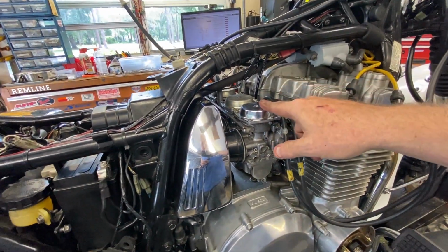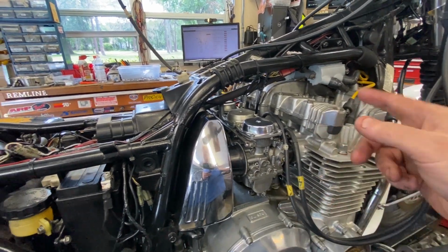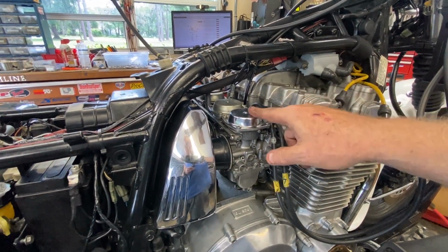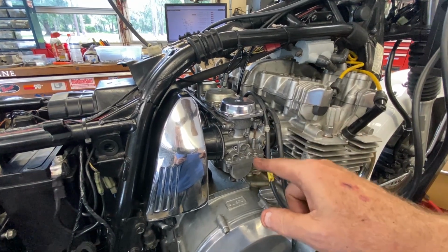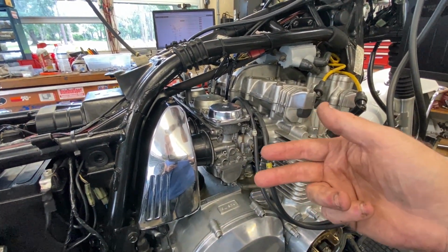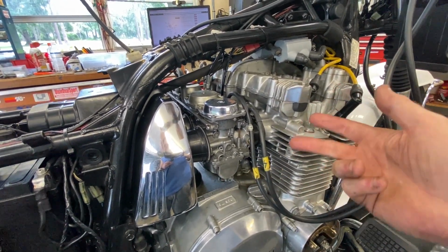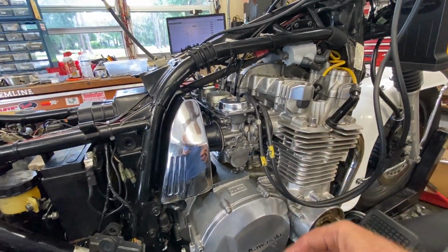Again, after reading some of you guys' comments, because your comments have been really helpful. It's another thing I wanted to talk about, and I'll get to the comments in a minute. So I richened up the 37.5, which I thought was in there before, two steps. I measured it out. It was 13 thou for the gauge pin, and then I went to 15 thou. Stuck those in, so they should be a 42.5.